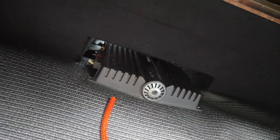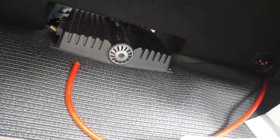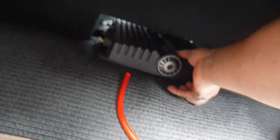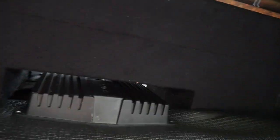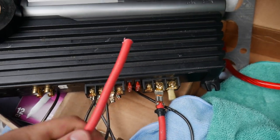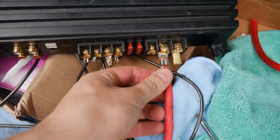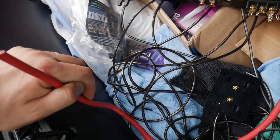It's going to be close on that side. I'm also connecting it to a power block, so that's going to take up some wire as well. Right now the amp is facing with the wires connecting that way. If we just pull this out and rotate it around like this — even that's still pretty far. We connected another positive wire which is also four gauge, and that's going to give us a little bit more room to run through our power block.